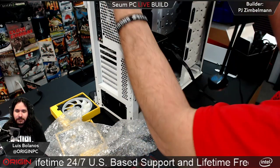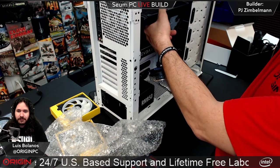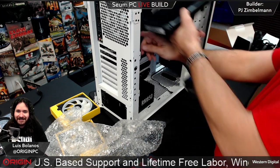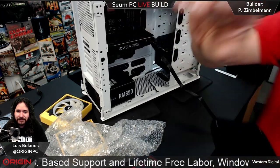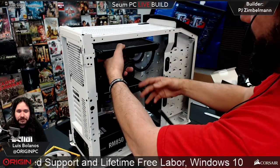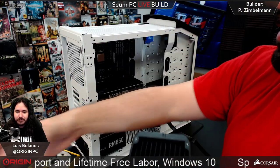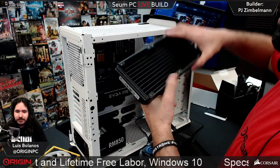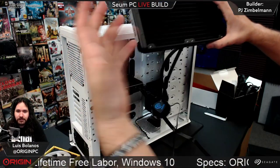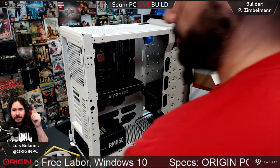So depending on the direction, I have the direction flowing this way, so it's going to intake liquid. Hold on, move the camera up. Into the top. I'm sorry. Cool it, and then this fan here in the back. There you go. Right here. The air is going to come in from the top, so it's going to intake. The heat that's inside the computer is going to pop out the back. So there's an intake and exhaust. There's a flow exchange this way. So it's just like a car radiator. You have two fans on top of it. Once the car starts to heat up, the fans kick on to cool the car off. Same concept. So it's a loop of cool liquid and then hot liquid.